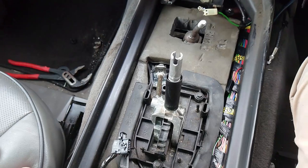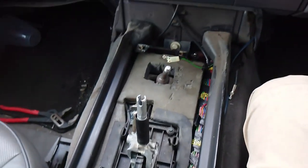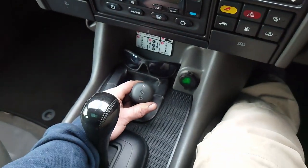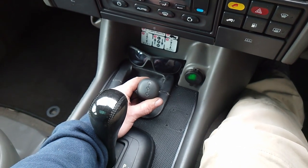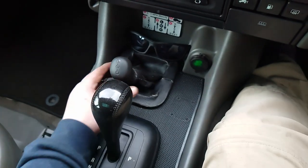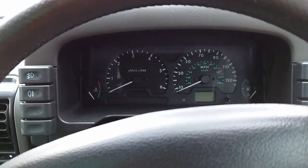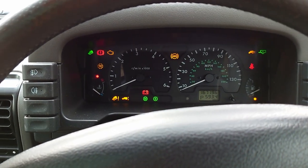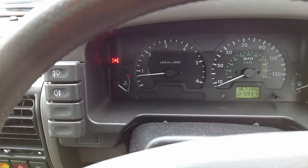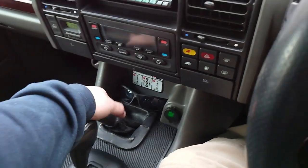It's quite easy to knock it out of park. There's no lock on this cable; you just pull the cable and it'll go through park, reverse, neutral, drive. If you haven't got the handbrake on and you knock it out of park, you could start rolling forwards. That's basically it — this is done. I've put the old shifter on for now as I've ordered a 300 TDI shifter but it's not here yet. As you can see it now moves across. Engage there — there's your diff lock. Pull it back — there you go.